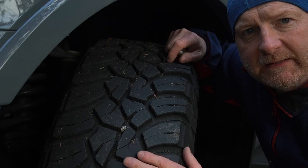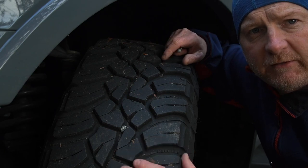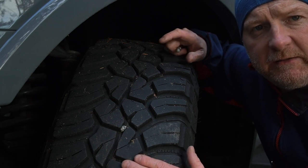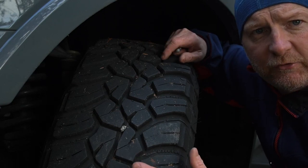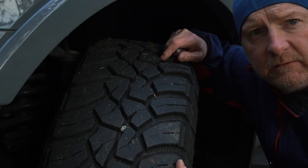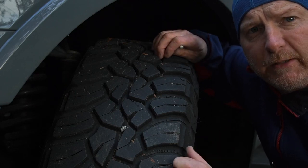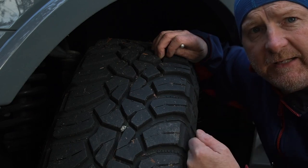We aired down the tires to 35 psi from hot. When traveling they were 45 and 42 psi front and rear when hot during the day; we aired down 10 psi less, giving us 35 and 32 psi with the trailer. I didn't want to run lower than that with the trailer on the back. It actually did help the drivability of Fred 2.0 and the trailer. Pros: solid 10-ply tire, airing down — they did an amazing job.